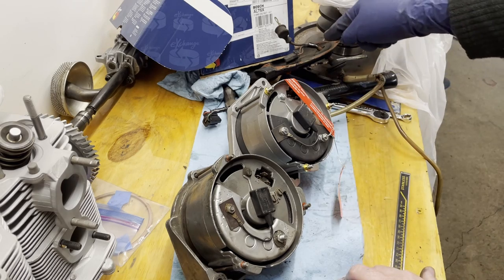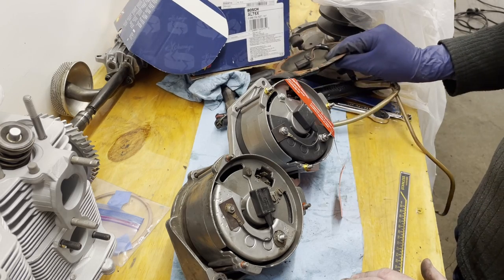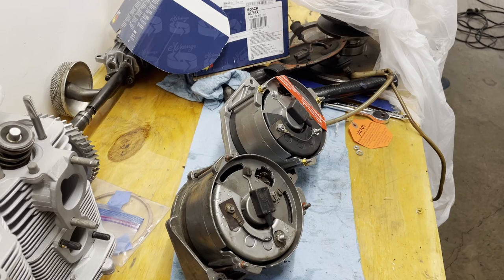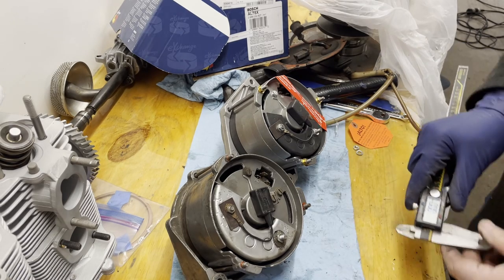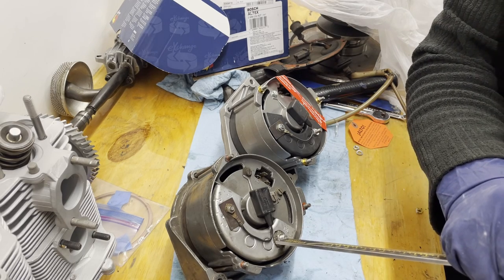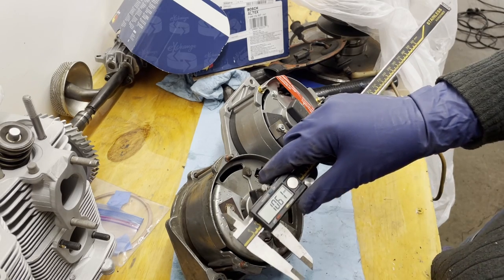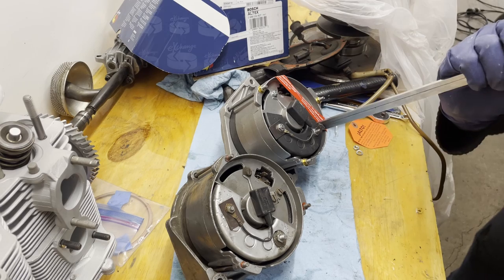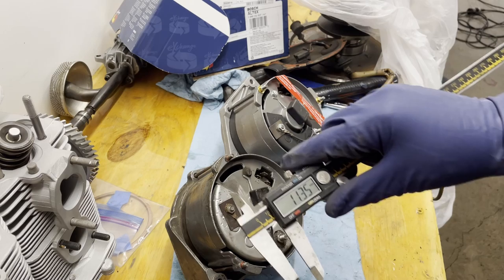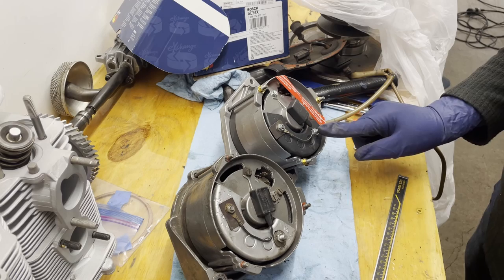I'm very careful to make sure that when we put this new one on, we're not getting even closer to the ground — because remember, this is 12 volts and this is going to be ground. I've taken the nut off so I have a better reference. We do have a little washer here. Measuring again: about 10.61 on the old one, and on this one — top to the washer — we get about 11.35. So I'm immediately concerned about this one being a little higher.